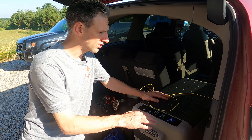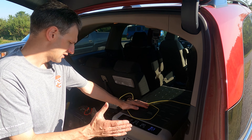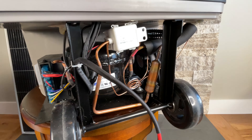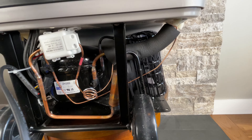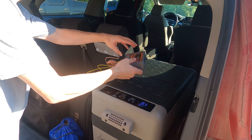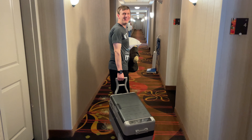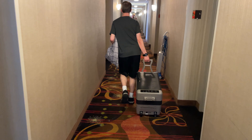I started the car and the unit's powered up, temperatures are all set. I made sure to leave clearance to the areas where air needs to flow so it can flow through the compressor area and not overheat. I stuck the thermocouples in, got the data logger on, and we got on the road. The first eight hours went just fine. We had easy access to the cooler, and even though the fan makes some noise, you really couldn't hear it over the engine and road noise.